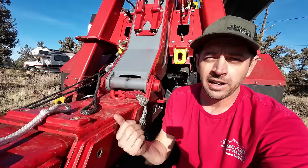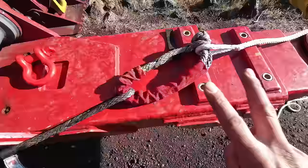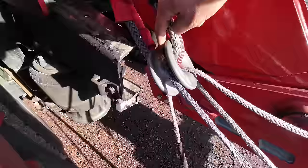To connect these two lines, we have three main options. Number one: hard shackle — but as you can see, when this gets up to the ring, it wouldn't be able to pass through or around. Number two, and probably the most common with synthetic lines, would be the soft shackle — loop it through this loop, through that loop, they're soft shackled together. But just like the hard shackle, it will not go through that hole. I can tell you from accidental experience that it absolutely will go around the outside of the groove if you're winching and not paying attention. It'll do it. It's not good. Pay attention — please don't ever do that.